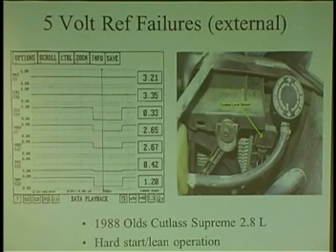You know, if you wanted to, you can cut the wire, because maybe it's partially shorted somewhere. It could be touching the block somewhere. Seen that? So if you want, before you spend big money, just cut the wire. What's it going to cost you for a little bit of solder? Put it back together. But you can't just cut one 5-volt. Because here's the thing. The 5-volt regulator could move out the different pins. It can go this way. There could be 3 5-volt lines coming out of here. One could be bad, and it could take the other 2 out over here. So then you got to cut all 3 5-volt references.